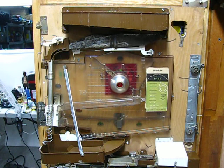And of course if it paid out, you assume that everything's working just fine. But I didn't think that was good enough. I like to see all the mechanisms working in the back to see if anything's loose or anything can cause a jam. Without a partner to put the balls in the front, it'd be very hard, because by the time you placed the ball in the payout pocket and ran to the back of the machine, it had already paid out and you couldn't witness what was going on.